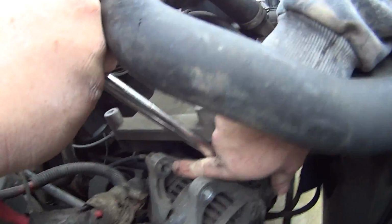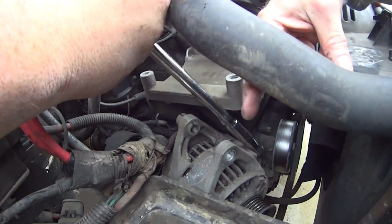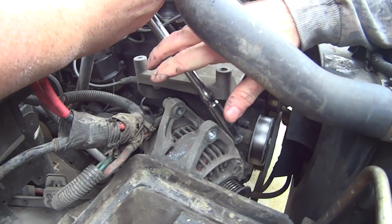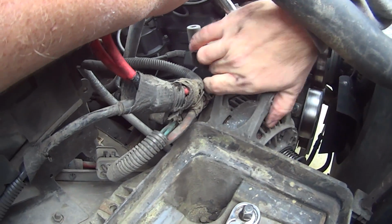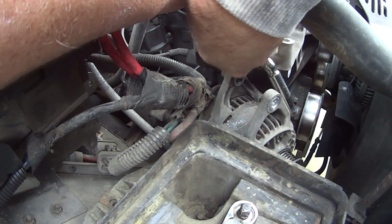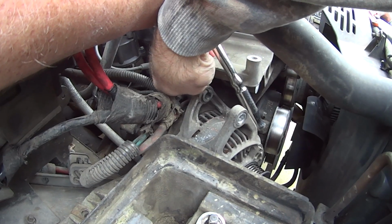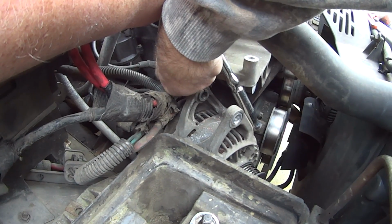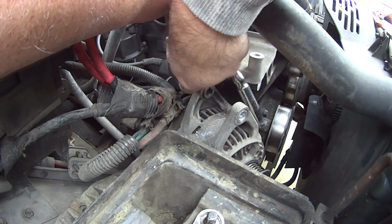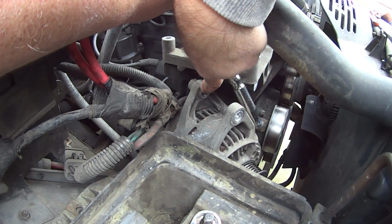But you see that bushing right there? What it's designed to do, when the bolt comes in, you tighten the bolt up, it squeezes all this together. It moves this bushing in, it squeezes on this bracket right here that holds it all in place. So that makes it kind of cumbersome to come out, and so basically you just kind of have to wedge it out. Now going back in, this bushing is kind of a pain in the tail also.